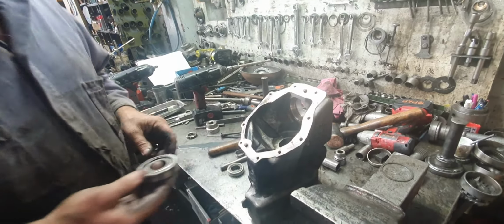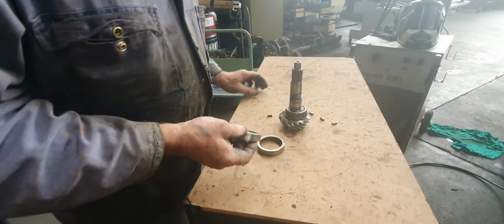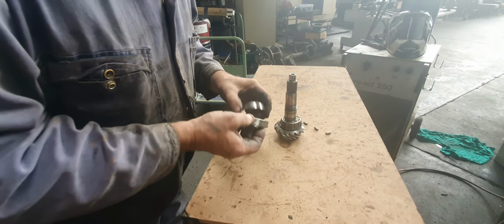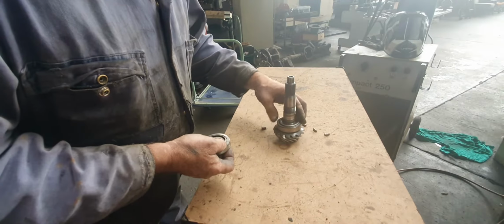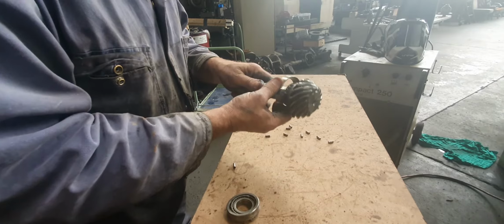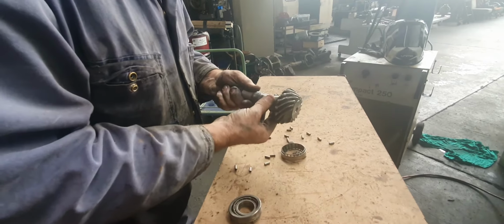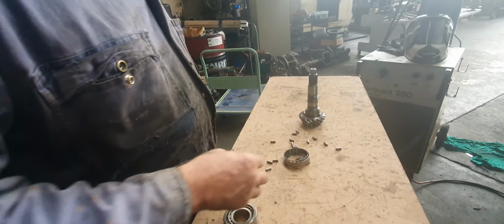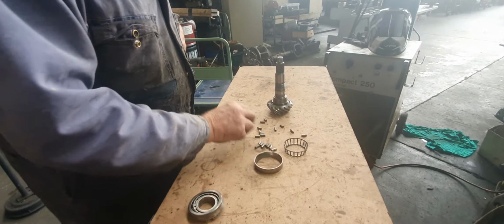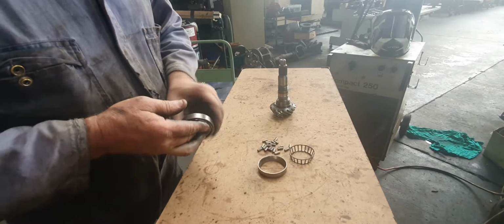That is the bearing. They use the front for the rear. See? Well, no, it's got a bigger bore, that's all. This has all been like this for months and months, years even, possibly over a year, all running around like that. And then they suddenly lose drive, or it's making such a hell of a noise, they then go to the repair shop and go, oh, I don't know what it is, it's been there for some time. That is the common front one, you see.